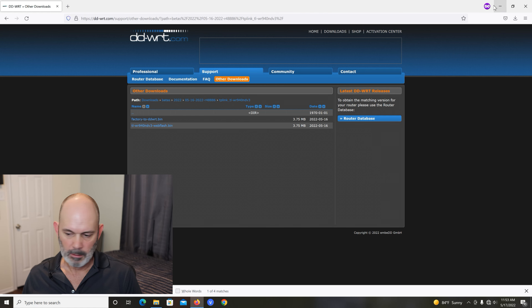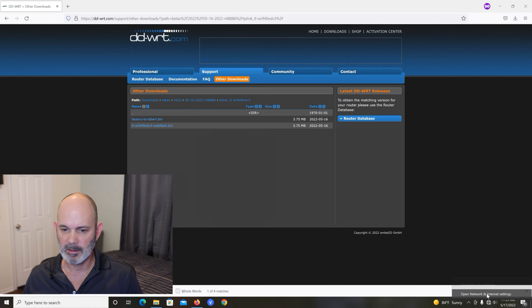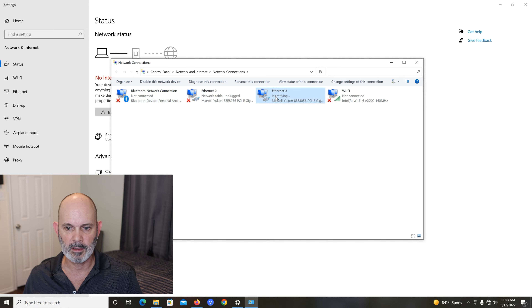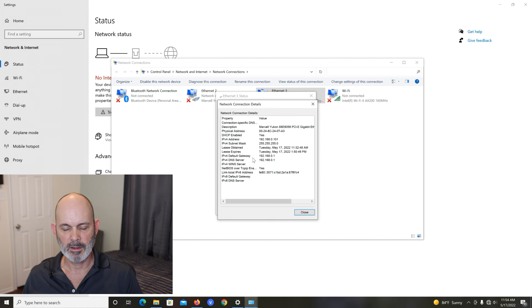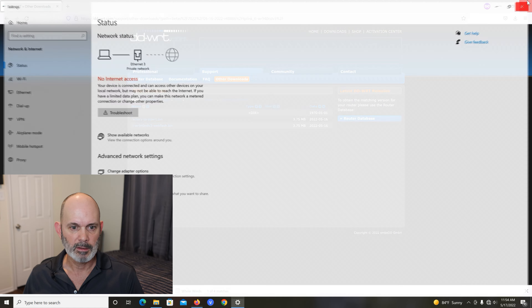Close this up and disable the Wi-Fi again. Now we're disconnected — power up that router. While it's powering up, if you want to see which IP address the router is at when plugged into your computer, do the same procedure: right-click, open Network and Internet Settings, go to Change Adapter Options, right-click that adapter, hit Details. You can see this one is on the same IP address 192.168.0.1. If these two devices are plugged in at the same time, your network will probably stop working because of an IP conflict.